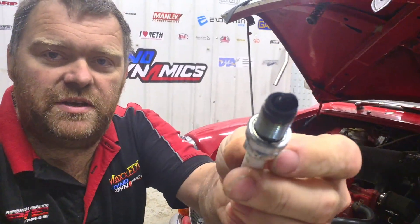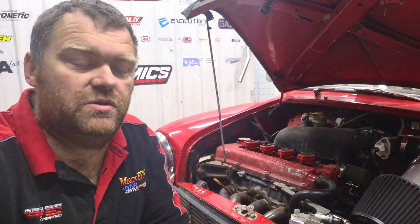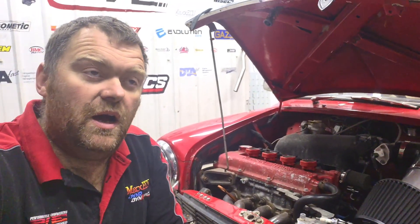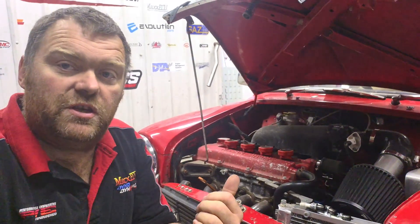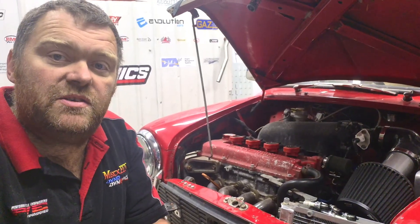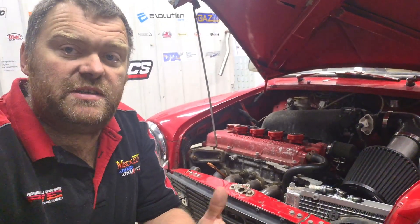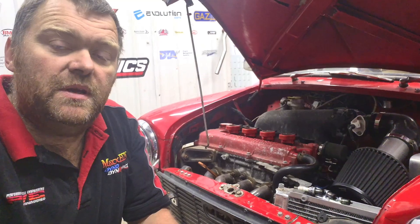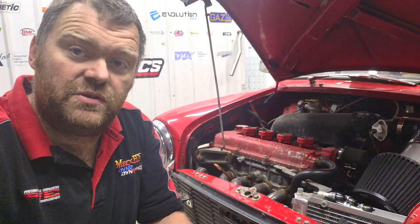Harness is in - nothing really more to do in the engine bay. The only thing I've done is put a set of plugs in because whatever the previous ECU tune issue was, it totally screwed them - very black and very knackered. So we've thrown a set of new plugs in. Now I've just got to wire in the tacho, and then we'll check for the crank and cam pattern because I have no idea what this engine's trigger setup is, having not touched one of these before with the Max. I know there's a 60-2 crank from previous experience, but I have no idea what the cam sensor pattern is.